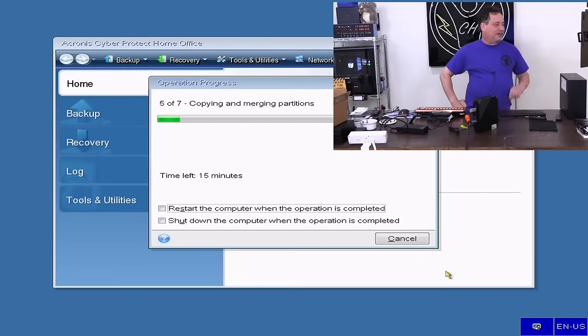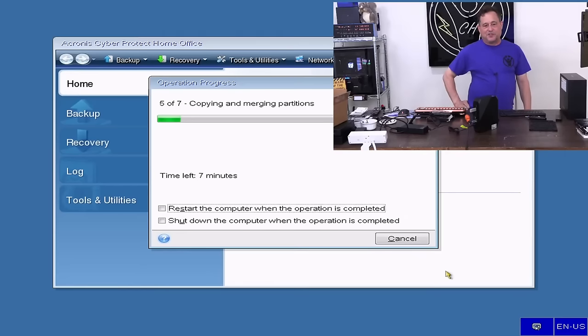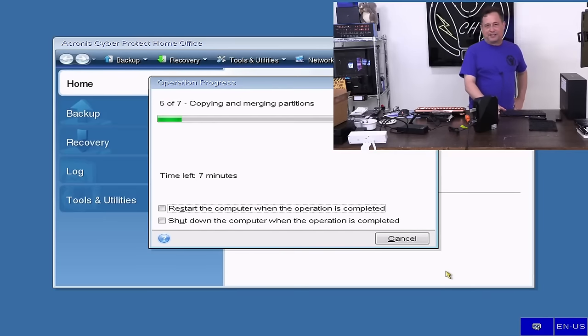Yeah, when I look at these little mini PCs from Dell and Lenovo and HP, I've got to tell you, the Dells, they stink. No USB-C, still running Generation 3 NVMe on a 13500 processor. Inexcusable. The HP minis, on the other hand, some of them have two M.2 slots, both Gen 4, and in many cases, they cost less. I don't know why Dell is making these decisions, but to get a brand new or fairly recent Dell mini that has no USB Type-C, it's got a spot for a second M.2, but they haven't soldered a connector onto it. I guess you got to pay extra for that. And the one you do get only runs at Gen 3 speeds, and Dell wants to tell you that this NVMe drive is a Type 35. What's a Type 35? Well, that's some nomenclature Dell made up, and nobody in the industry uses it.